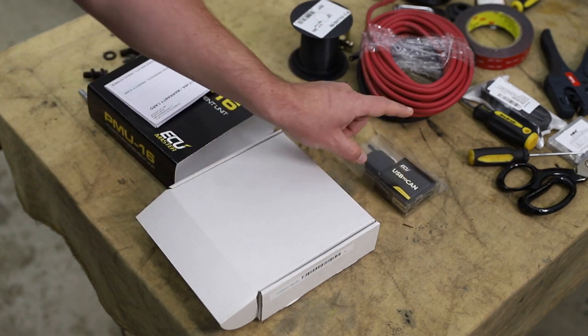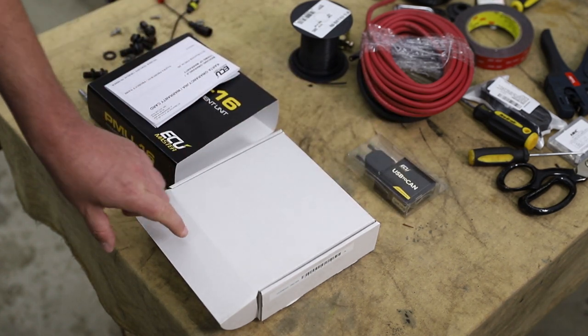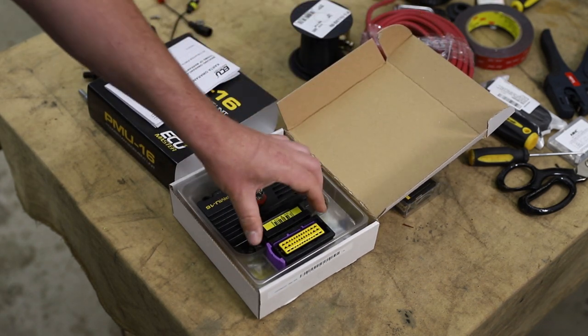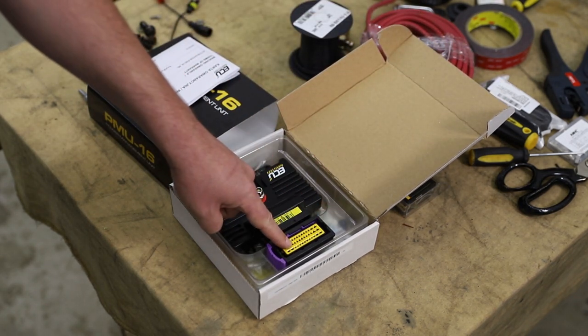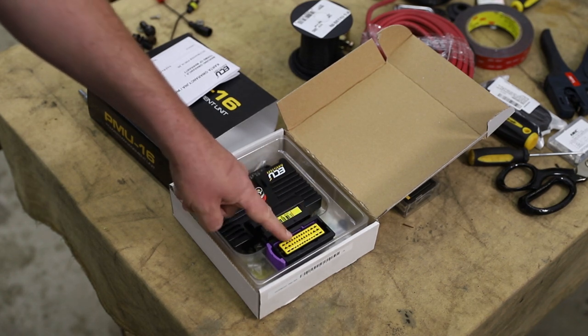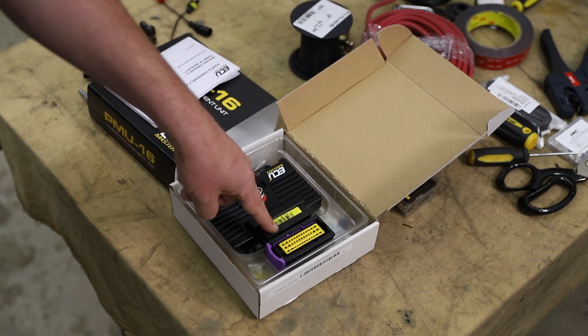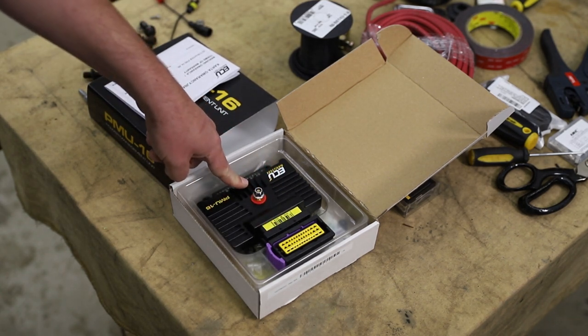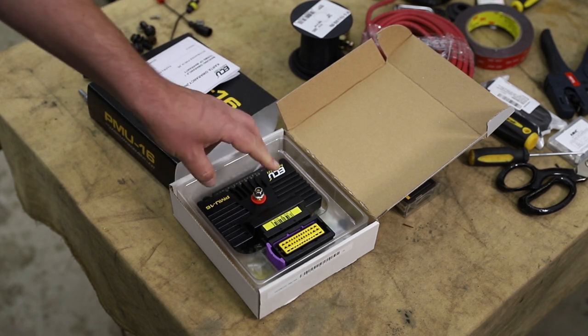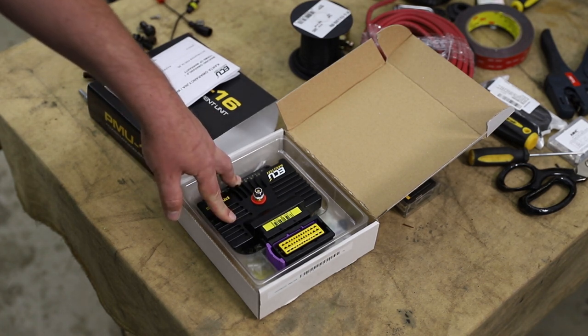Now keep in mind, this signal has to go through the same giant plug output here. So you'll want to figure out which of these are the CAN connections, and in your wiring diagrams and your design for your harnesses, carry those to somewhere you can connect to. Otherwise, you won't be able to program the unit easily or make changes after it's under the dash of your car. So let's go ahead, get it out of here, and see how it fits with the other components in my 240Z already.